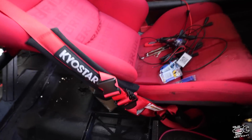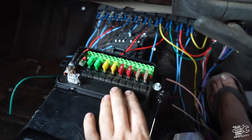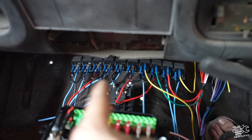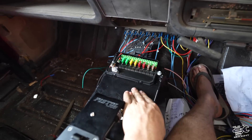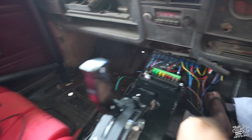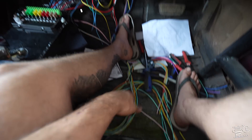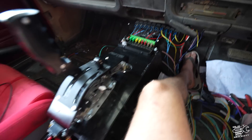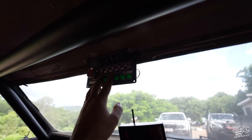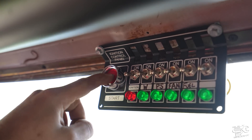I've put together a little battery box and decided to put it in the car between the seats - it's out of the way but keeps the engine bay nice and clean. I've mounted the electronic solid state relay box, got the relays up there, fuse box there which will feed all the relays, the shifter, and the control box for the lights, then a main breaker for all the fuses. The task now is to wire everything back to the battery. All the cables are here - everything from the back is this loom, everything from the front is that loom. Up top is the switch panel: ignition, water pump, power steering pump, fan, fuel pump, a spare, and the start button.